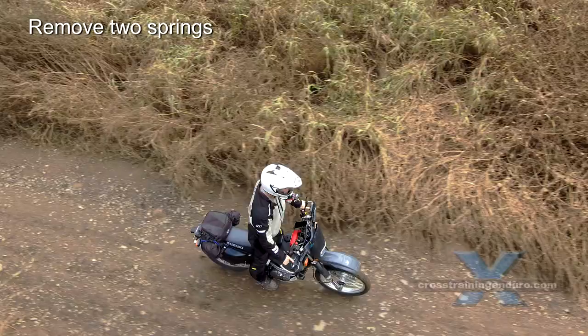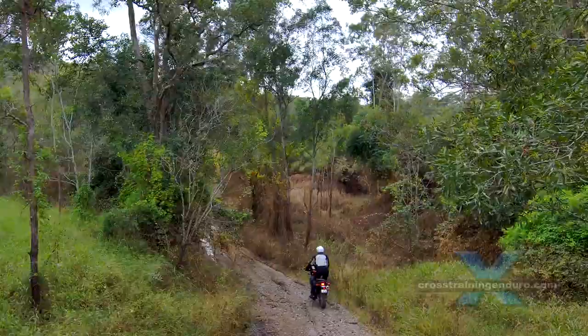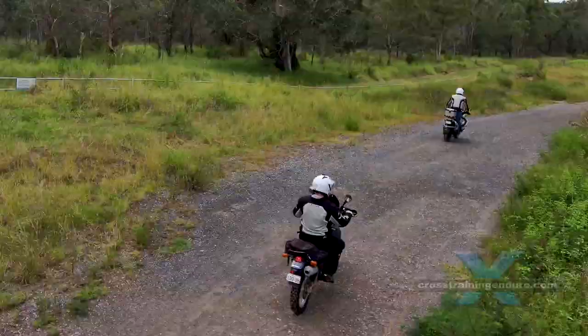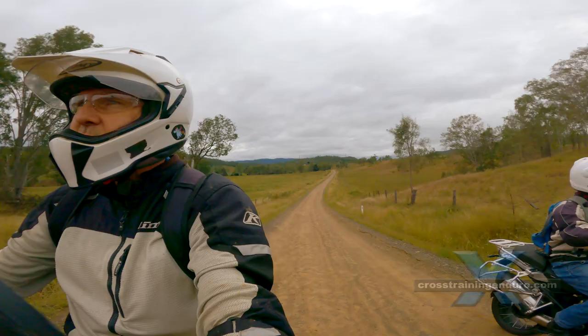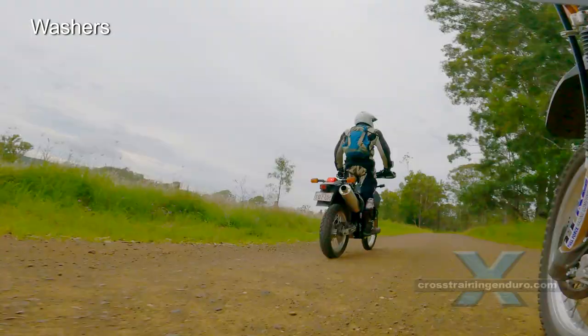Our final free tip: if your clutch has six springs, remove two clutch springs. This needs a big disclaimer — try it at your own risk. But quite a few dirt riders do this on bikes that have excessively heavy clutch springs. To date, I have not found anyone who caused damage with this technique. I suspect it would never suit aggressive riders, as the 33% reduction in clutch pull will probably lead to clutch slippage at full throttle. But plenty of everyday riders say it has worked brilliantly with no negative effects. Let us know if you tried this and encountered problems.